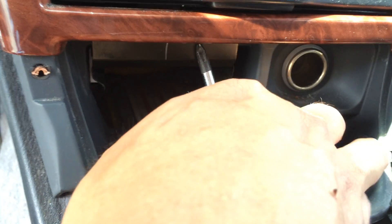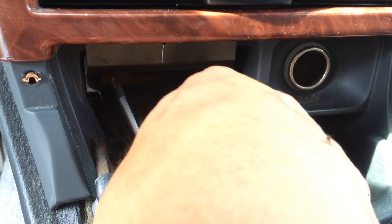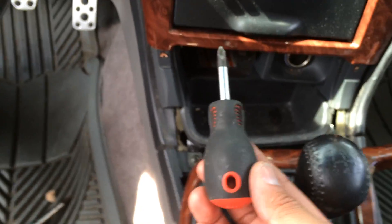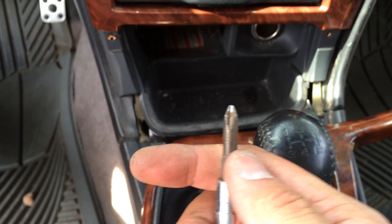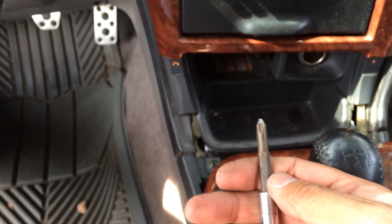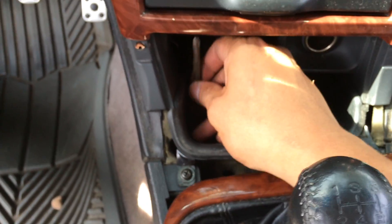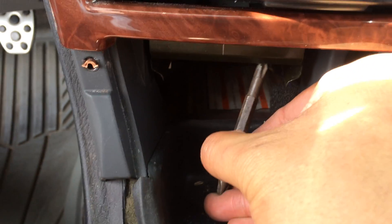This is what you're going to need the long Phillips to get to. Down in here you're going to need the stubby screwdriver. Underneath here there's one here and then there's one here — Phillips — and they're about finger-tight. If you don't have a stubby screwdriver, you can use a four-way or ten-way type screwdriver, pop the bit out, and do it by thumb, spinning it on either side.